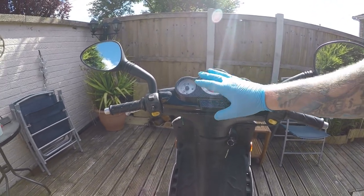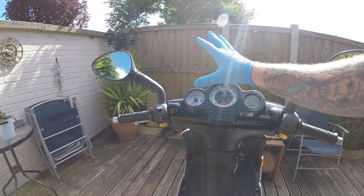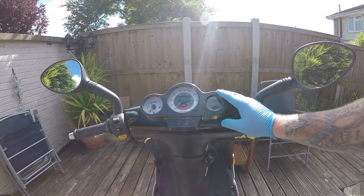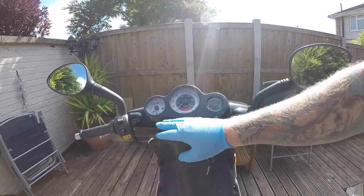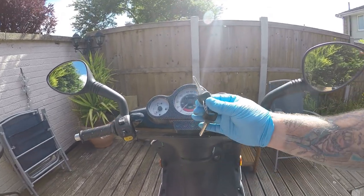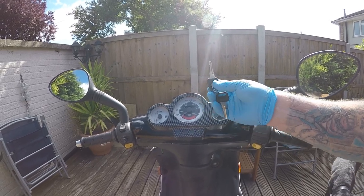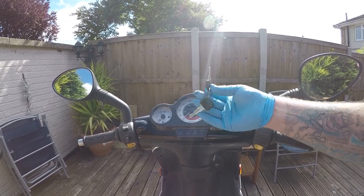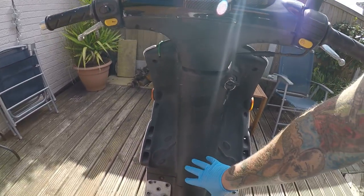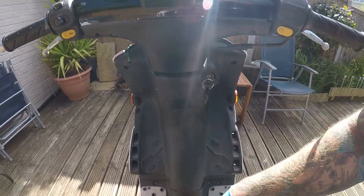Dash is loose. Petrol gauge didn't work — the dad whacked it and up it came, which isn't right. We'll check all the electrics here with WD-40 and check under the seat when we get that out. Obviously the temperature gauge is not going to work either — none of these worked at all. Nice having two keys. This model is a non-immobilised model — it's got a big fat key. If it's immobilised and you haven't got spark, it's a world of pain. The power regulator is under here, so this is why you've got to get all the panels off.